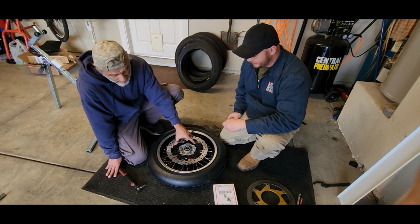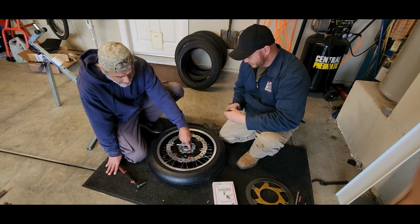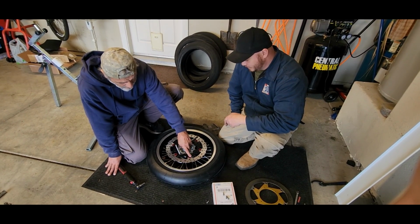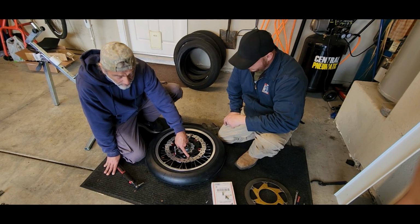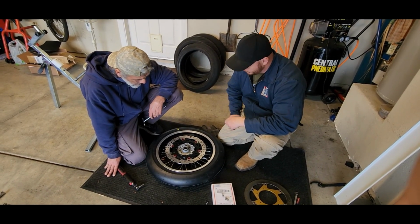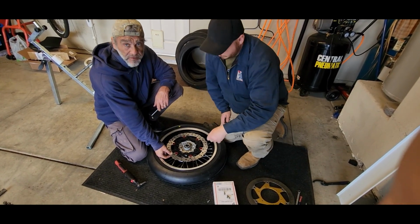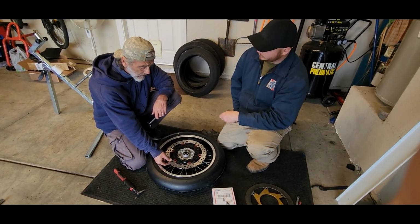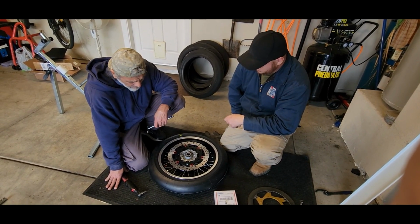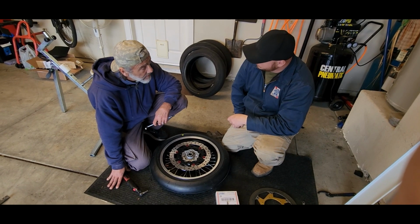So in this case, our BrakeTech rotor is directional. That's because of the design, and the brake force holding against the stops on the carrier, instead of the buttons there. I love that design, seriously. It's really genius, and it's simple. I don't know if I mentioned how much thicker this rotor is. That has some importance too, in regard to heat and durability.